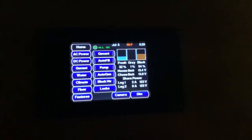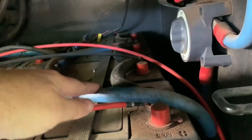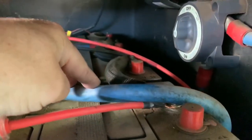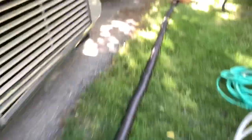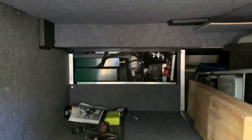Let's head outside and do a shore power and DC power disconnect on both sides. For the batteries, you'll need to disconnect three leads: one for the charge bridge, one for the inverter, and one for the house 12-volt system. I just use my disconnect switch. We'll do the same thing for the chassis. Now I should be 100% without power in here, which I'll verify with a meter just to make sure before we get going on some surgery.